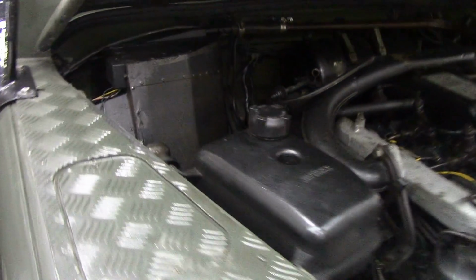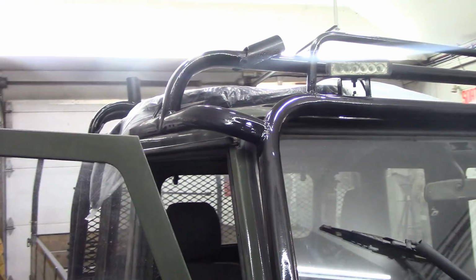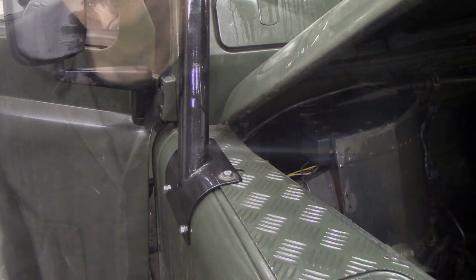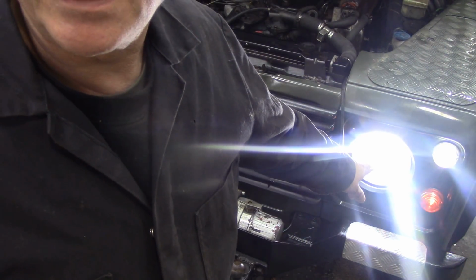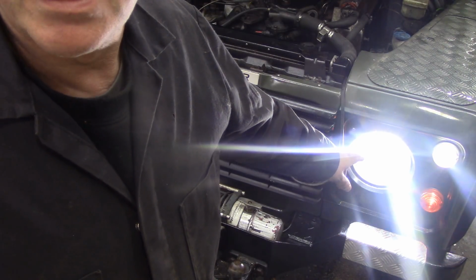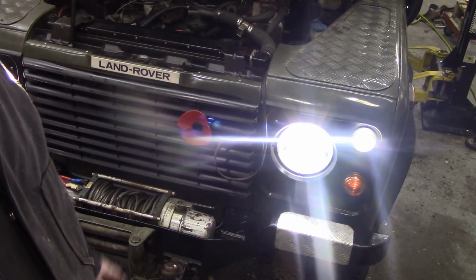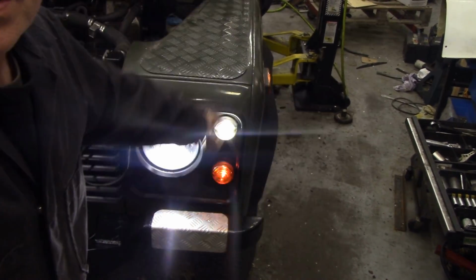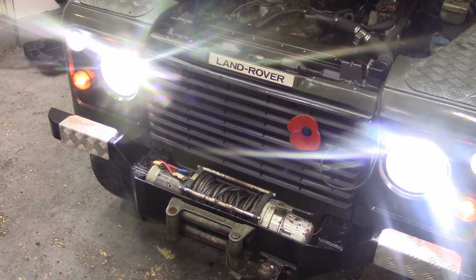Yeah, I'm quite happy with it really, it's done quite well. So what's next? I've got that door seal to fit, that's up there. No, check lights. Ah, that's right, we'll check the lights. Nice bright headlamps. These are actually Britrest headlamps, the glass ones, but I fitted LEDs to them. I put on the hazards so we can see that all the fronts are working, side flashes are working, that's alright. Let's test high and low beam, make sure that's working.